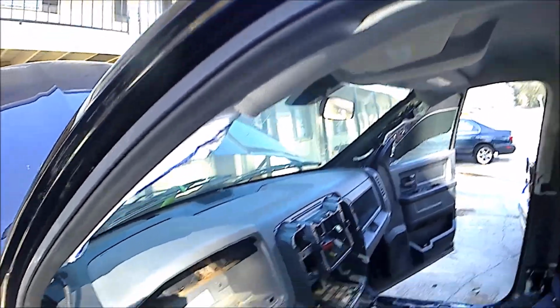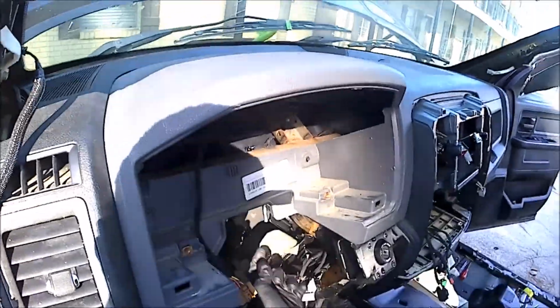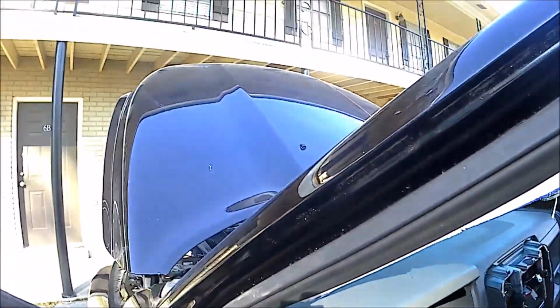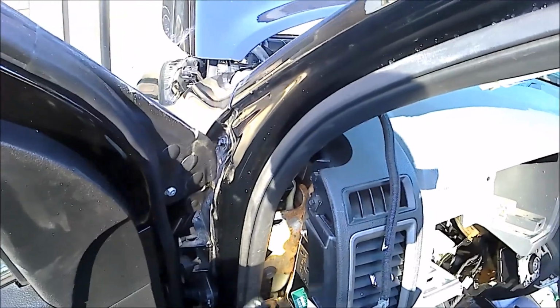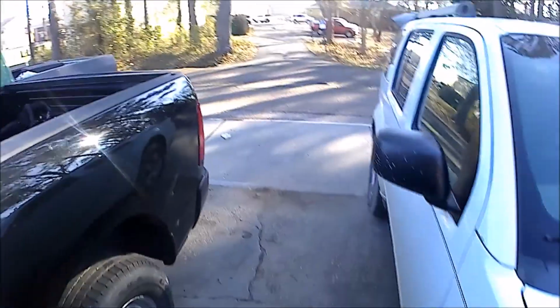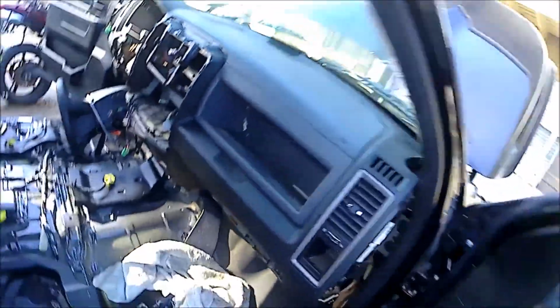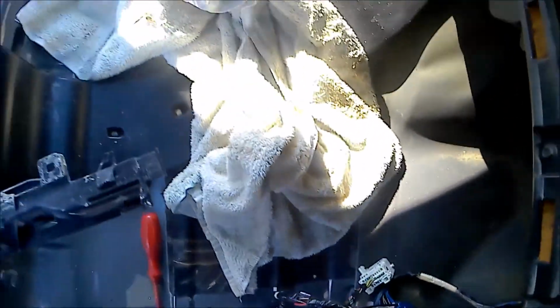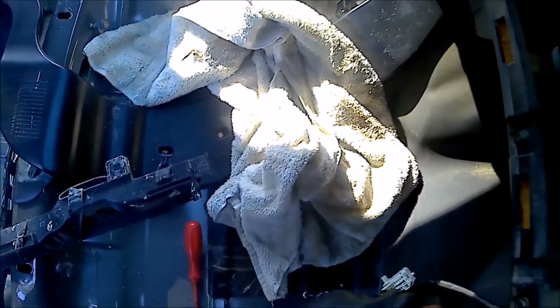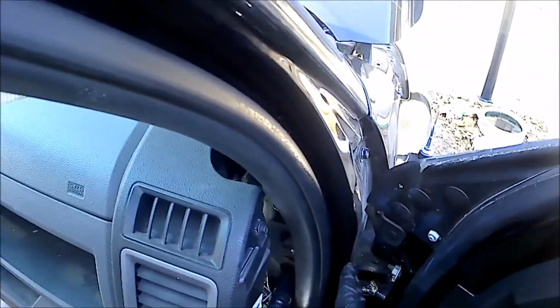I haven't gone much further, but I've removed the 10mm bolt that was down there. I just removed the two 10mm bolts that go behind the 13mm studs. I've unplugged that one. I've removed two of the 13mm bolts here. I've left one in to hold it up. There is either not a retainer there, or it's broken. I'm gonna remove this one.